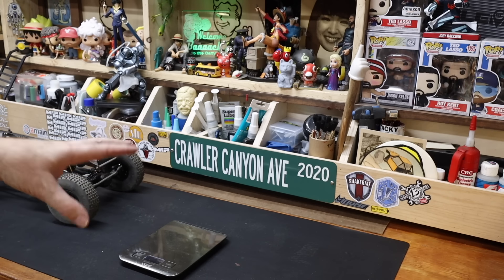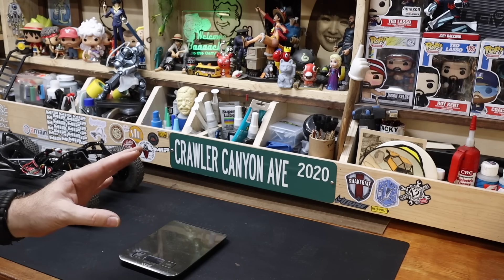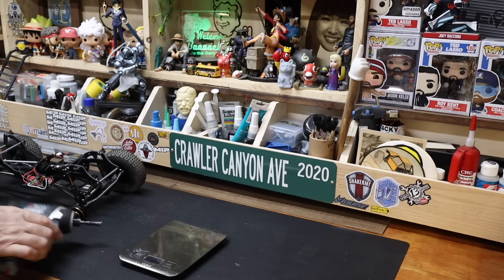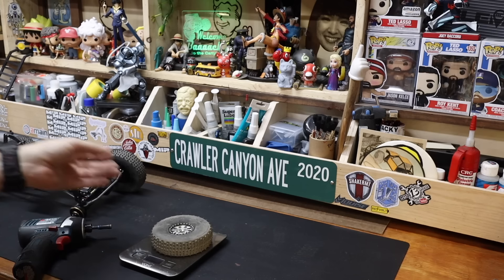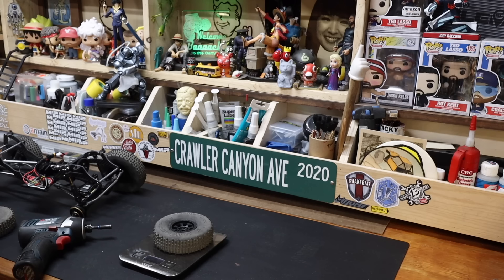Now, the CG — which we'll talk about momentarily — the CG got worse. I knew it was going to get worse because we were removing weight indiscriminately. Some of it was rotating mass — I'm fine removing rotating mass — but along with that rotating mass is also unsprung weight. We removed a bunch of unsprung weight. These are the old fronts, replaced with the Vanquish fronts: 127 grams replaced by 100 grams, so that was a 54-gram savings there.